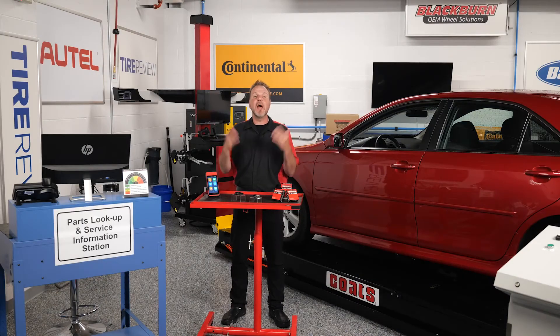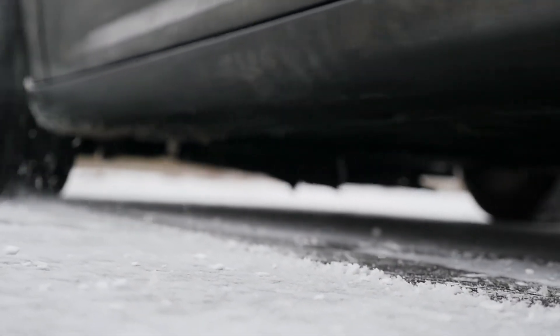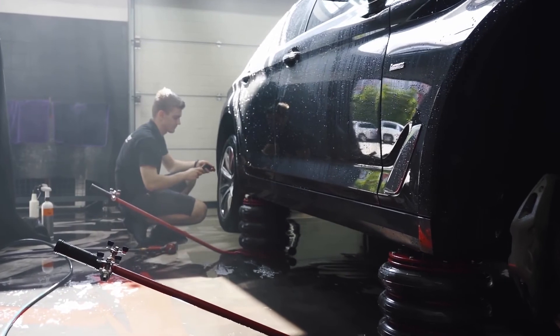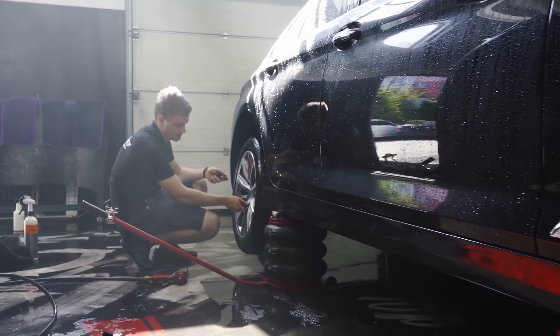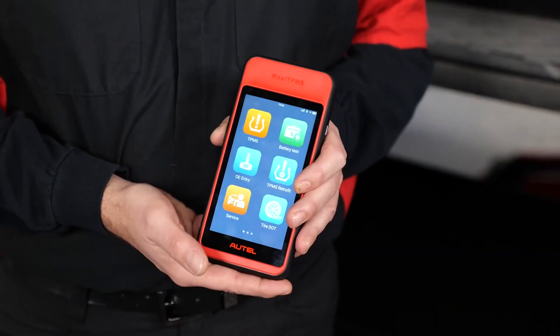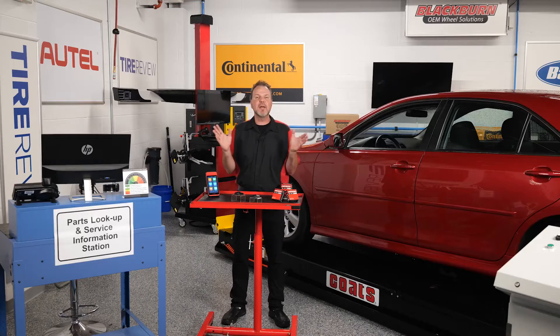It's a great way to set up an extra set of sensors to match the current sensors on a vehicle. More and more common all the time, people are getting an extra set of wheels with winter tires, or they're getting a set of wheels and tires just for the summer. No matter how you look at it, it's a year-round opportunity for sales. With the Autel ITS-600, the OneSensor, and the copy-by-OBD method, you can confidently offer this service to customers. And when they change over their wheels, they'll retain full and correct TPMS function without the need for any additional programming.